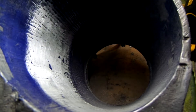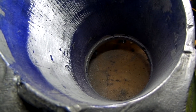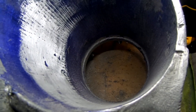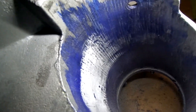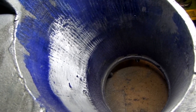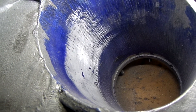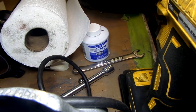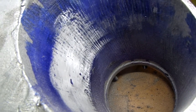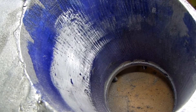One of the steps to mount these CV axles is to basically put the hub and the brake on the swing arm, then slide the axle in the back and check for interference in this cylinder here. I did have some interference. I put this Dykem layout fluid — you can see it there — and painted the inside of this thing. Then I put the axle in after I assembled the brake and the hub to the swing arm, tried to rotate it, and there's some definite interference.